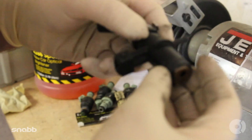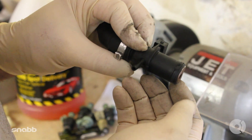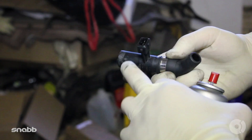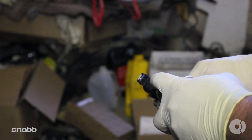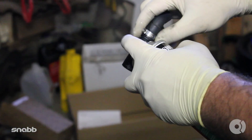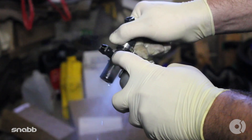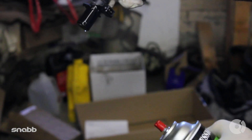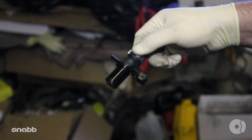Most of that's pretty smoothed out. We can clean the rest of it up with a razor blade. After you've smoothed the edges out, make sure you clean this well with brake clean — all the ports. Want to make sure there isn't much oil left in there.